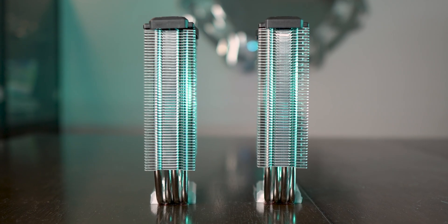So yeah, pretty decent air coolers. I expected nothing exceptional from them given how compact their heatsink size was — both models share the same heatsink. Most of the work is likely being done by the fans anyway. So if you need a compact, no-RGB air cooler in your build, you can definitely consider either of these. But I wouldn't really want to pair them with anything above Intel i5s or Ryzen 5s — and I can't even say that confidently for Intel 12th gen i5s since they can produce a lot of heat and power.